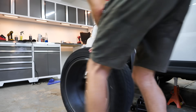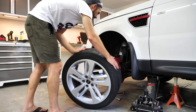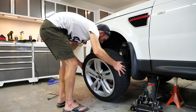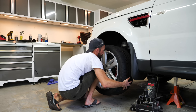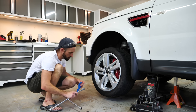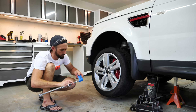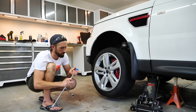When putting the wheels back on the car, be very conscious that the paint is not completely cured — it usually takes a full 24 hours to completely dry. If you can keep them off the car, that's best, but most people don't have that opportunity. One thing to do is take your lug nut wrench and wrap it with some masking tape or any soft tape, so that when you're putting on the lug nuts, you're not going to scratch the inside of those wheel lug nut holes.